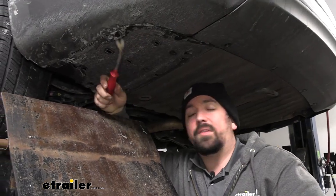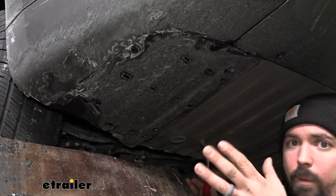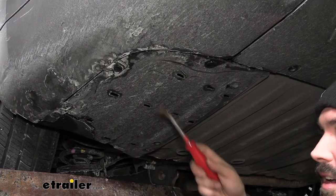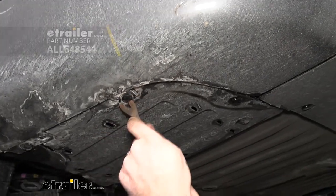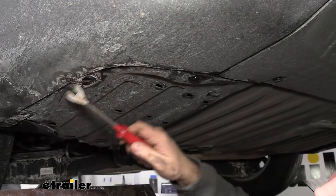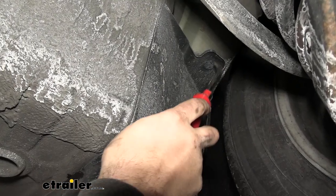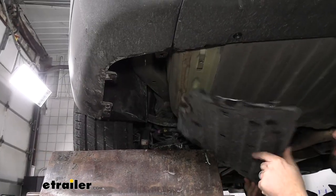To begin the installation, go underneath to the driver's side where there's a plastic panel that needs to come off to gain access to the frame rail where we'll bolt the hitch. We won't be reinstalling this panel because the hitch will live up here. If you're also doing wiring, now is a good time to have that wiring handy since it plugs in here as well. To remove the plastic push pins — there are four of them — pry the center part out and the whole pin should come out. Work along the outside edge and get the one tucked up in the wheel well, then pull the panel off and set it aside.